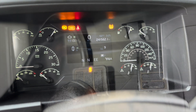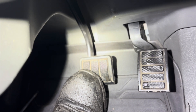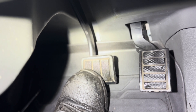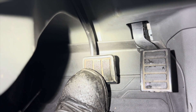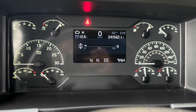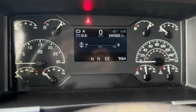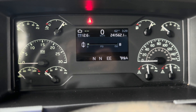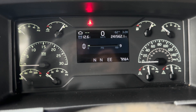I'm going to hold down the brake pedal for about 10 seconds and see what happens. As you can see I'm pressing the brake pedal all the way down — make sure you press it all the way down, otherwise it does not calibrate properly and you'll be wondering why the lights are not going away. And there you have it — everything is calibrated again, all the lights in the dash have gone away.